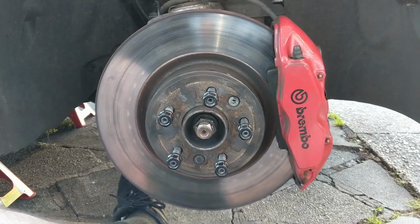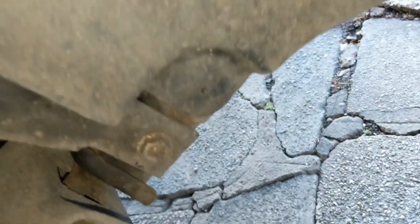Okay, next I have the wheel off, and I'm going to remove the front section of the arch liner. To start with, there's 1, 2 7mm headed bolts, and also there's these round plastic clips that are dotted about. I do have a special tool for these, but you can probably find a way to bodge it.